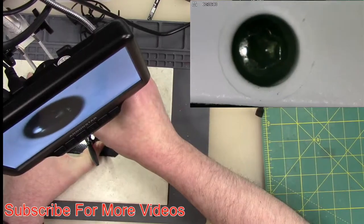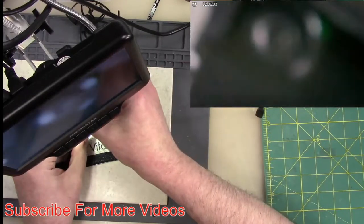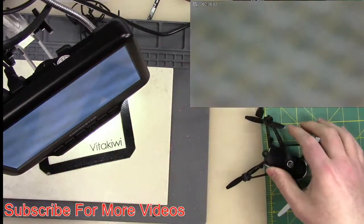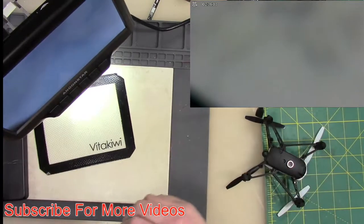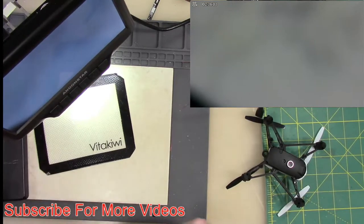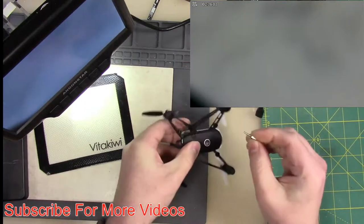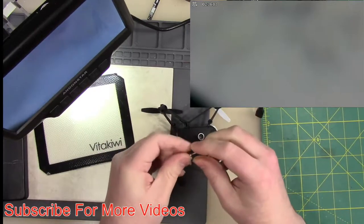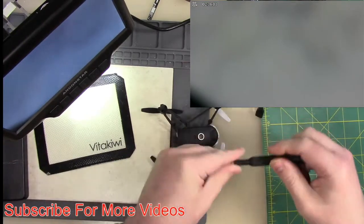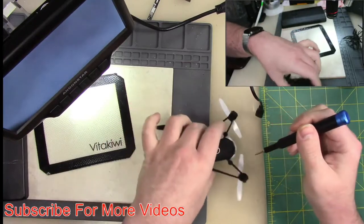Okay, so yeah, that appears to be a Torx screw. What about the ones on the bottom? Same screw. Yep, same size screw. It's a Torx screw. So we'll get my iFixit kit over here. And oh, that's a small boy. I'm gonna try this one here. And that's it. That is a Torx T3. So we are gonna go ahead and shut that off. Put that back on here. Okay, so we got a Torx T3.